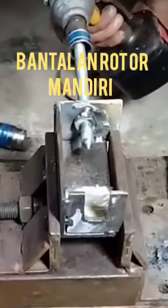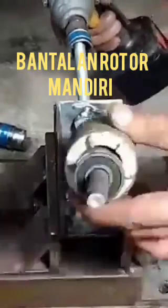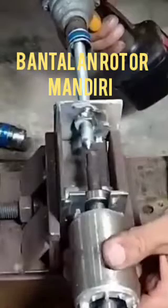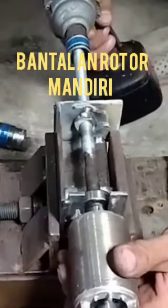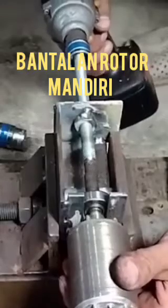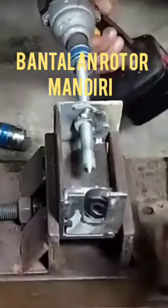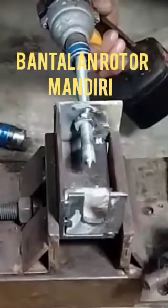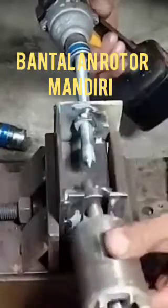We use it in the live video from the side or in the workshop. This is the tool for removing the rotor bearing. We have installed it like this, and after that we can tighten the screw by the tool to remove the bearing from the self-starter rotor.